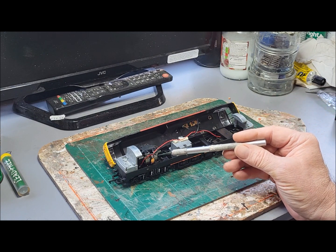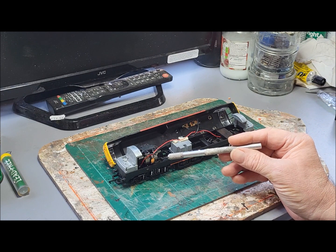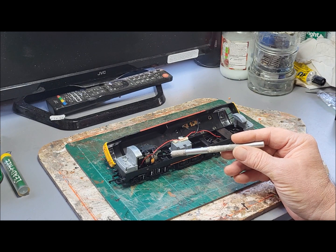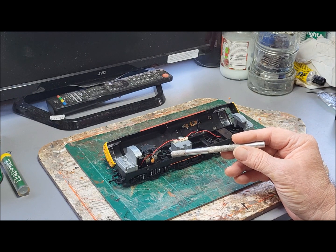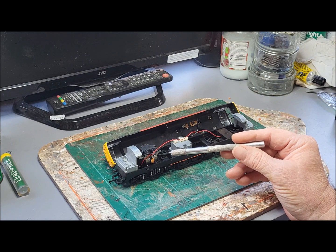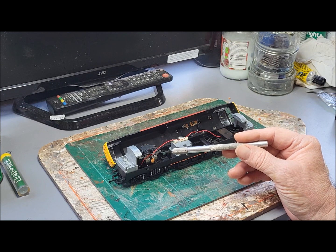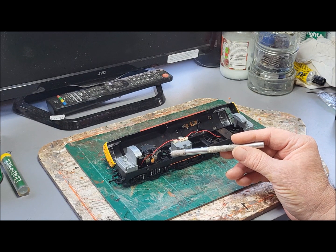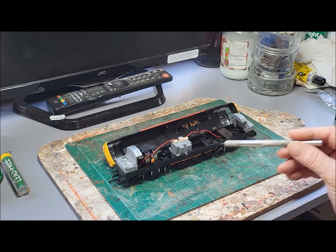The wiring here is going to be a little bit interesting. We've got several wires going into what looks like a capacitor and a bridge across there. So that's going to be interesting. I think the first thing I've got to do is get rid of all these gubbins here, release the wires, and then see whether these two brush covers are going to cause a problem or not. Depending on whether they're live to the chassis or not, that could mean that we need to insulate one of the screws.